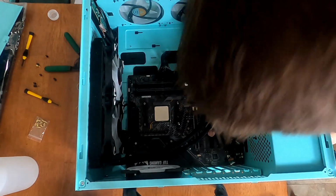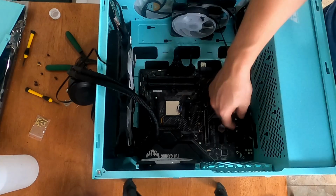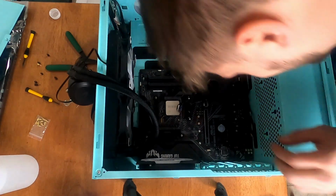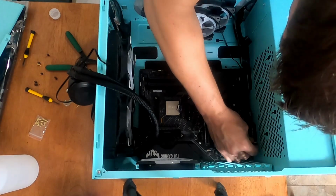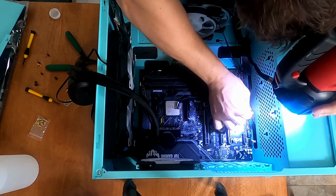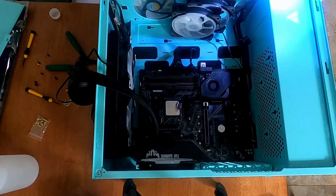So let me get these two USB plugs done and out of the way, because those are easy. USB 2.0 installed. Okay, so that was one USB plug for two ports. Over here, my AAFP looks like a USB, but the pins are different. So for HD audio, that's going to go into the AAFP header right here. HD audio installed, USB 2.0 ports installed.